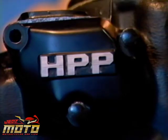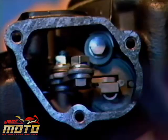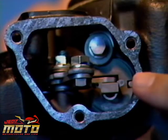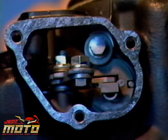Does it require special maintenance? Ideally, both exhaust valves and their guides should be decarboned every 2.5 hours of engine operation. The service manual does a good job explaining troubleshooting and service procedures, so use it when the time comes.